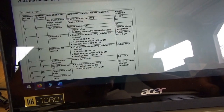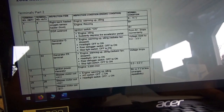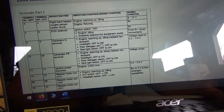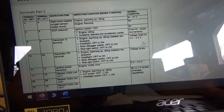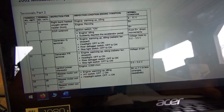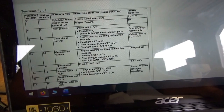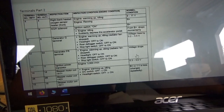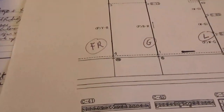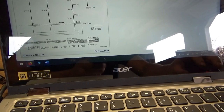When the battery positive voltage — S voltage — reaches the regulated 14.4V, the field current is cut off. When the battery voltage drops below the regulated voltage, the voltage regulator regulates the output voltage to a constant level. And then in connector views for the engine computer, generator G terminal — you do these things and you expect voltage rises by 0.2 to 3.5V. So you turn on all these accessories and the voltage should rise. FR terminal — you do the same thing, turn some loads on, and the voltage drops. Again, you expect to see 12 volts on there. Not the best description and operation here in terms of testing.